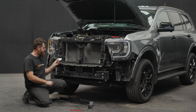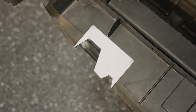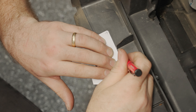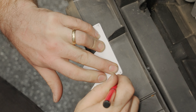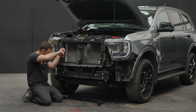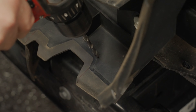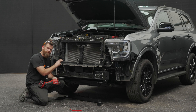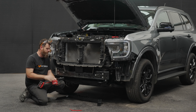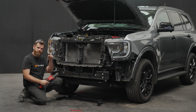Grab your template out of the kit — it's used on both sides. Grab yourself a pen. It's a bit of a funky shape but it'll line up with the shape on the soft rubber here. Mark the two little corners, poke your pen through on the center lines, and mark all the way around. Then grab a 6mm drill bit, line it up with that little pin hole, and very carefully drill through on each of the four corners. Now that we've drilled our holes, we want to cut each of those three lines. It is quite thick plastic, so use a fine-tooth saw, reciprocating saw or even a grinder. Very carefully cut down each line and break that out. Don't forget your safety glasses.